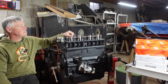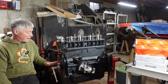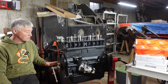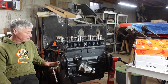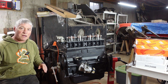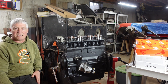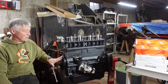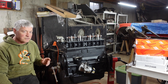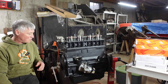So we're going to rotate the motor here a couple of times until I figure that out — I'll watch for this cycling and then find the next top dead center. Now I do have an aftermarket pulley here. I mentioned that before when I was putting the motor together, because I'm doing the fan delete and I've got a harmonically balanced pulley here. I did mark top dead center, but only with a Sharpie marker. This pulley has to come back off because I've got to get the timing chain cover on there properly and get the seal in there.